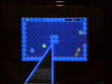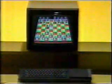To show the graphics of each machine to best advantage, we asked each manufacturer to choose its favourite graphics programme. BBC Graphics can take as much as 20k of memory. With a resolution of 160 by 256 points, this gives an impressive 16 colours. Maximum resolution is 640 by 256, with just 2 colours. The QL can afford to give away 32k for its graphics, although the best it can do is 8 colours at a resolution of 256 by 256. Maximum resolution is just double this, at 512 by 256, and that's with 4 colours.